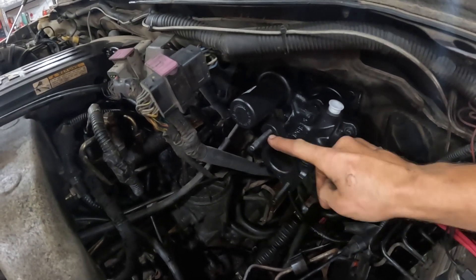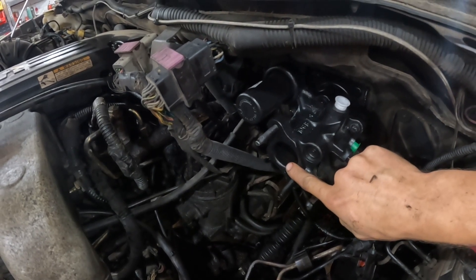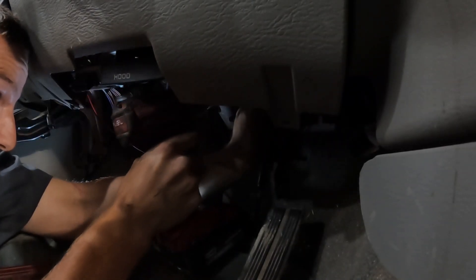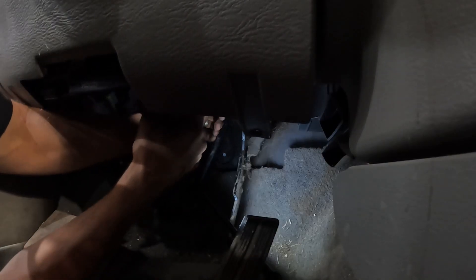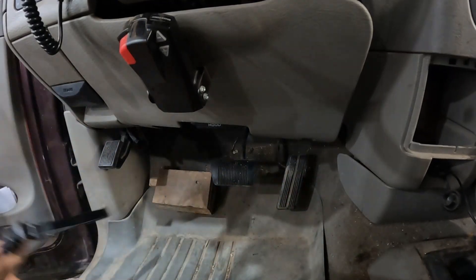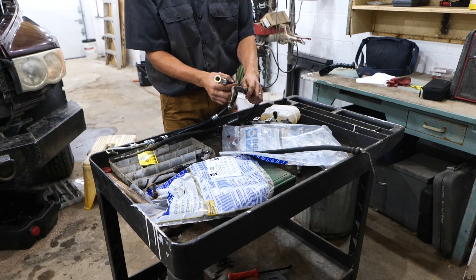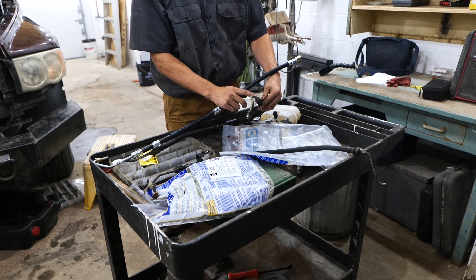This is at a crazy angle because there's actually a second plate that goes on there — that's a retainer for the spring and stuff, which I forgot to transfer from my core. Don't forget this little clip; this is how you attach the brake pedal. These lines are a two-piece deal, so you have to save this aluminum end. That's the upper section and it threads to this.